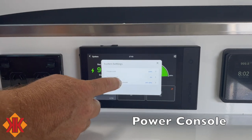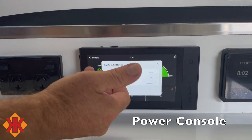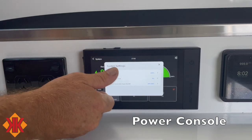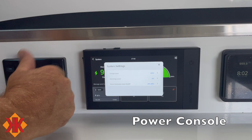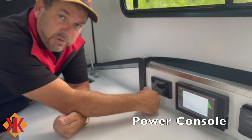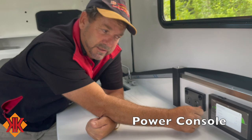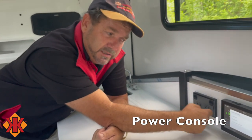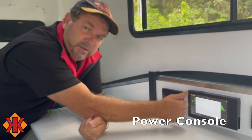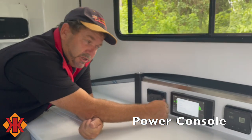In the top-right settings you can configure charge level, discharge level, and connect a smart generator. EcoFlow smart generators work really well with these vans — they're no noisier than a Honda EU20i. The factory setting is to charge to 100 percent and allow discharge down to zero, which EcoFlow recommends.